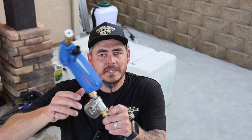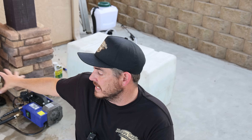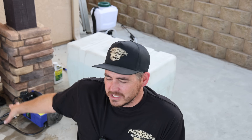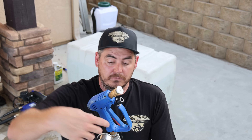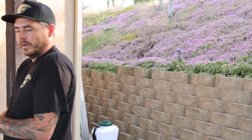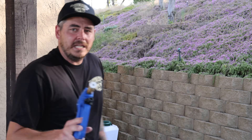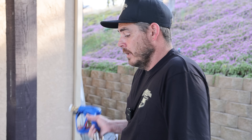I'm going to zip tie the nozzle in the compressed mode so the motor is running, and test the decibel level while it's running. I'll take it down so we're not getting the pressure noise, just the pump itself. Before that, let me check the amperage — it maxed out at 14.86 with this 5.0 nozzle, so we're operating under 15 amps.